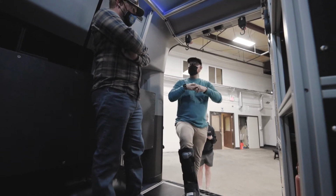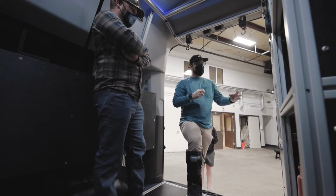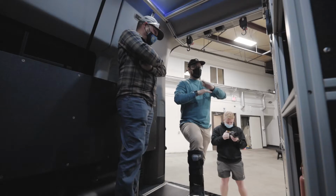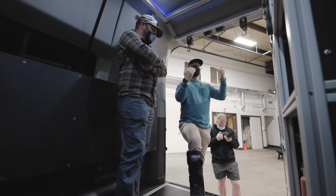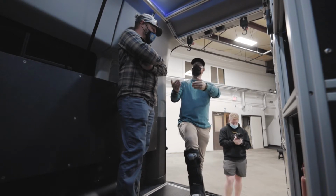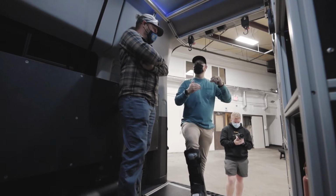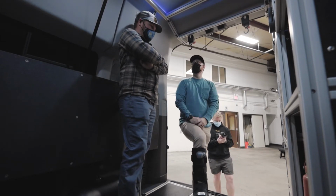They are directly connected together, both systems. And in the middle of that is an automatic charging relay, which is right here with that yellow switch on it. Its job is to just connect the two systems and disconnect them based on voltage. When we're above a certain amount, usually when we're charging, you'll hear a click, it connects them. We are now sending power to the other system and charging it. When we drop below a certain voltage, you'll hear a click, it will disconnect, making sure we're not pulling from that other system.